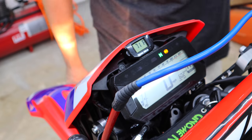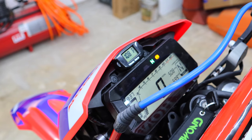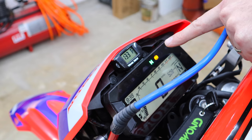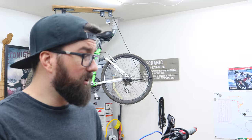The temperature gauge has come up just a little bit — let's run the bike and get that temperature moving. It's getting warm, the thermostat's opening, and there comes the heat. Because of where the thermostat is relative to our sensor, the bike looked like it was barely heating up for a long time, then suddenly shoots way up — that's the thermostat opening and all that heat hitting the sensor at once. When it closes again you're kind of in the dark. That's still the main reason to have it: so you can monitor it if conditions get extreme. I'll let this thing fully cool down so any extra bubbles chase their way up, then top it off in the morning.